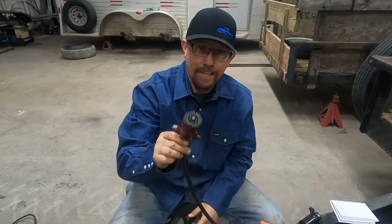So now that we got the cover on, we have our wires. And just check them out to make sure they're okay. Make sure they have a good strip on them. I'm gonna go ahead and recut all of these and restrip them just to clean them up a little bit. For 6-way wiring like we're doing, like I said again, this is 6-way utility wiring that we're putting in a 7-way plug. Just cut them all off the same length. Make them nice and neat. If you see any corrosion in here, you need to trim that back so you don't see corrosion. Sometimes the corrosion's so bad you have to replace the whole cord. We'll address that in another video.